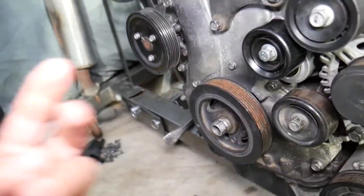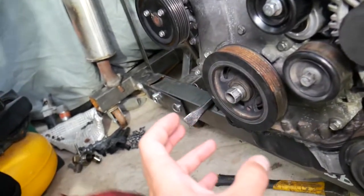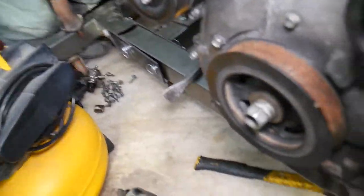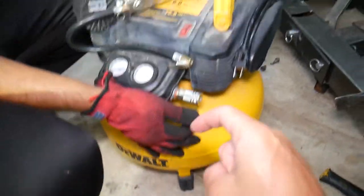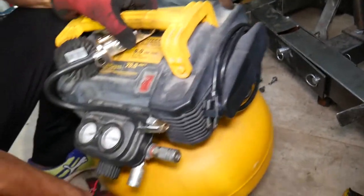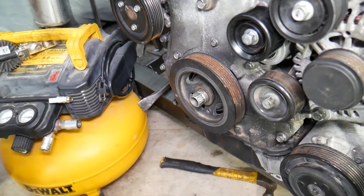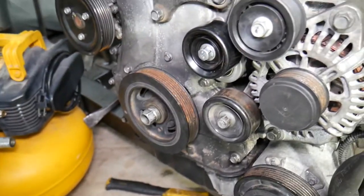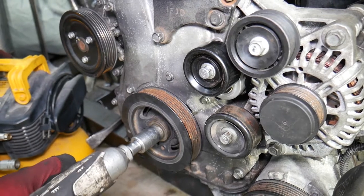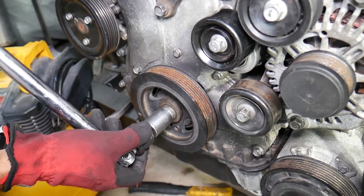There are two kinds of special tools - one on the engine starter location and one underneath the oil pan on the flywheel. Install that tool to set the crankshaft so you can remove the bolt. If you don't have that tool, we usually use a high-torque air gun with a compressor that pumps all the way to 165 PSI - we'll put the link in the description. We've already pretty much loosened it that way, but stay with us until the end and we'll explain exactly where to install the special crankshaft tool.